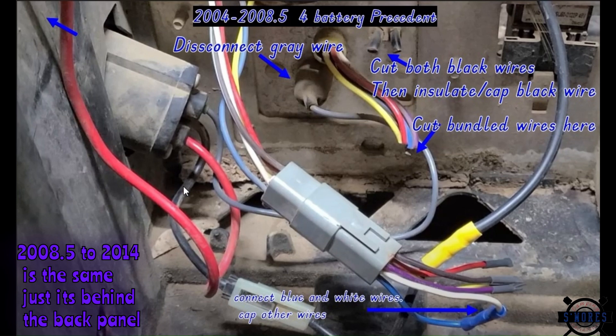This black wire right here is going to come through this connector. You can disconnect that — normally it would go right here and then this would go right here. This goes over to the B-minus terminal on the controller, so what we want to do is cut here and here. On the wire that goes to the B-negative side of the controller, you can either cap it off or cut it down closer to the terminal and then tape it off or cap it off there, and that takes care of that aspect.